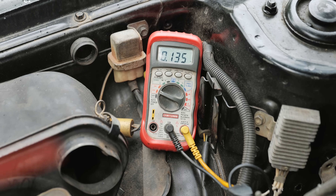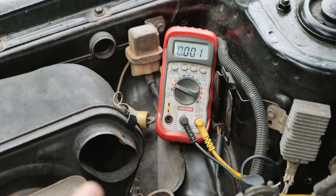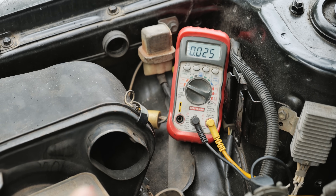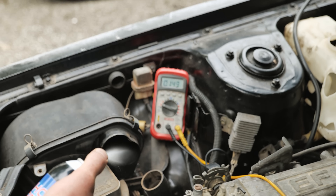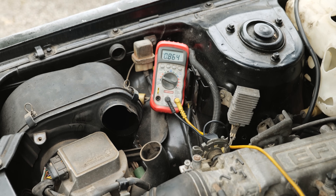Even though the O2 won't go to 0.8, the O2 is not our issue here — we're lean. Very lean, more than it ever should be — a negative voltage. See, I can drive it rich for sure. Yeah, there's 0.8.